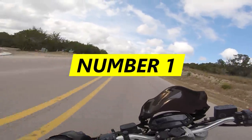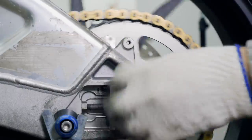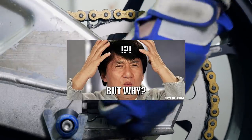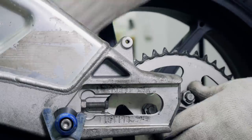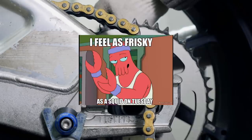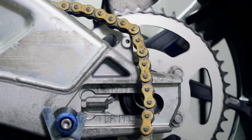Number one: one of the easiest ways to completely break your motorcycle is to not maintain your chain. This is a super common maintenance item that only takes a few minutes every couple of weeks, but people still say they only lube their chain once or twice a year, which is bananas. If you don't lube your chain, you're allowing grit and rust to build up on your chain and in your rollers, which ages it prematurely and stretches it. Chain tension is something you should be checking every time you bust out the lube, because a chain outside of spec can bunch up and snap in spectacular fashion on the road.